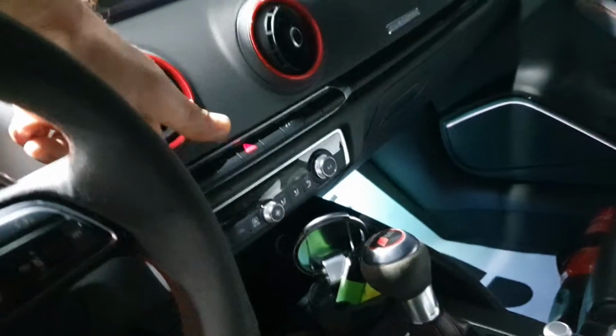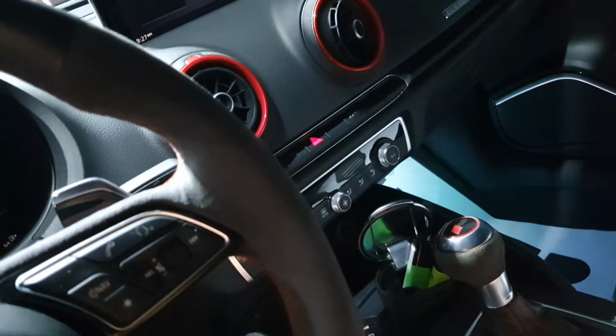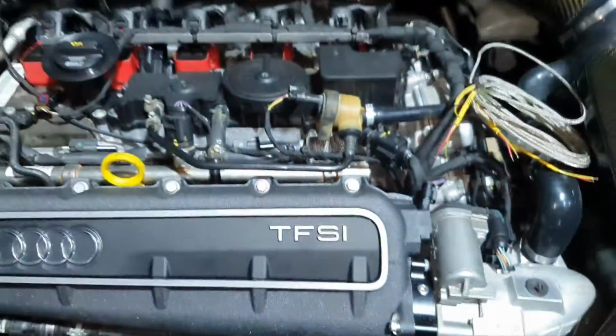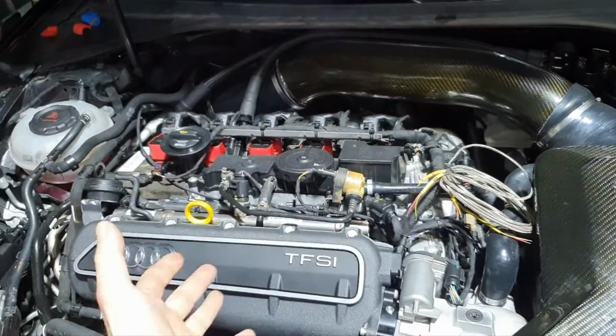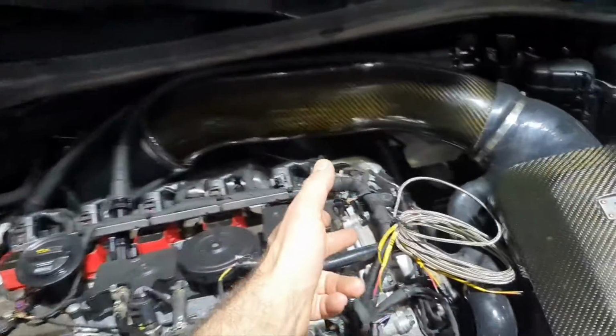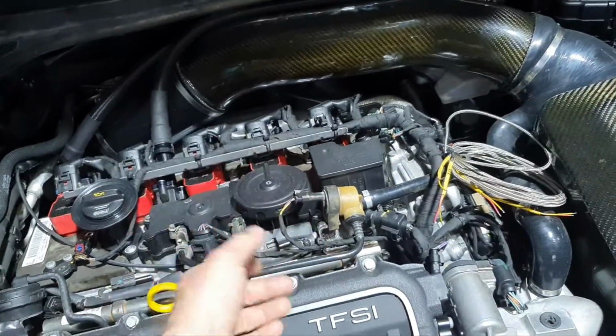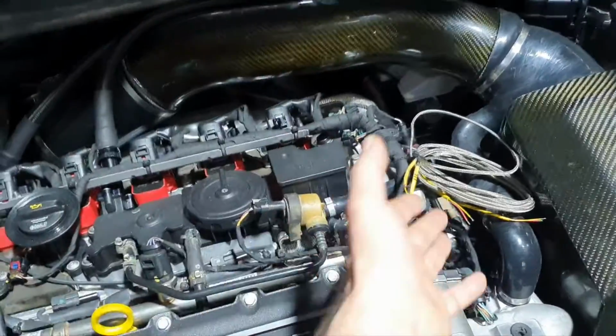I wish to have somebody here with me to do that for me and to see also the motor at the same time, but it's okay. It's silent. How lovely. Okay. The fan turned off, right? Yep. Excellent. Yesterday on the first start, like all first starts, you hear the cam adjusters and the hydraulic lifters. Hydraulic lifters are new, one camshaft is new, and the cam adjusters were empty. Alright.